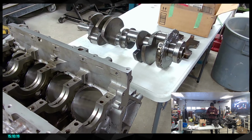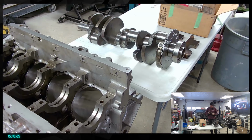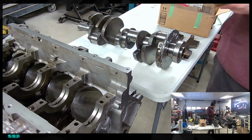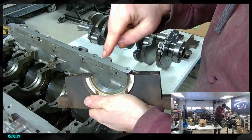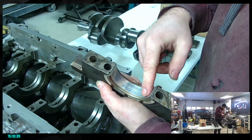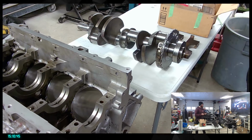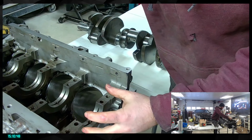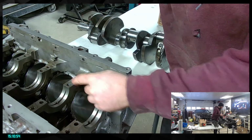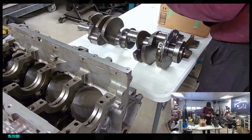When I removed the cam from the engine while tearing it apart, one of the cam bearings just came off with the actual camshaft, because it was pretty much beaten up. So yeah. Here you can see this is another style of bearing. That one is the one sitting in the middle, so it's acting a little bit as a thrust bearing. This one too is scratched quite a bit. That one is super important, because basically the shaft will try to move back and forward, and also shake up and down. And this one at the center is really helping a lot to maintain everything in place. So super, super important one.